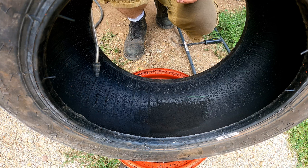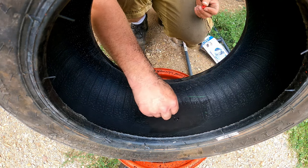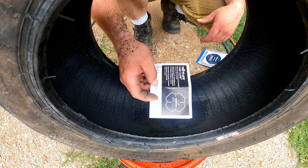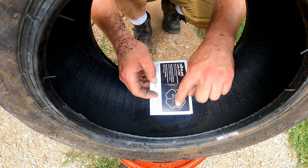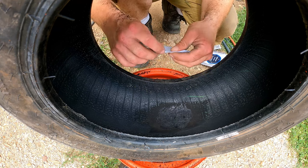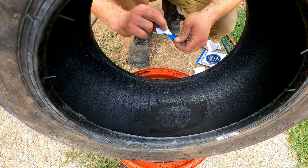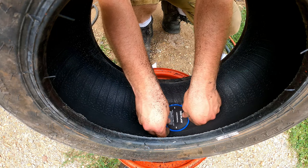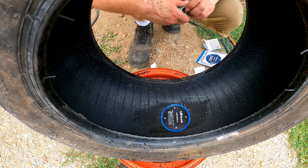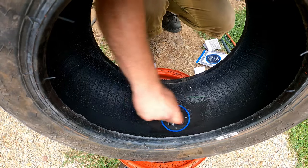Now I've got to clean this out and the best way I can think of without a vacuum is with air compression. The next step is to put the cement down and let it dry thoroughly. To orientate the patch — the bead should be towards the edges parallel with the lines of writing — we'll go ahead and stick that on. Peel the backing, apply it on the cement. When I was at the tire shop we had a wheel with little spikes that we'd use; I don't have one of those but I do have a caster, so we'll just use the caster and work it all over.